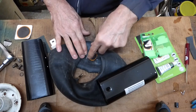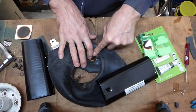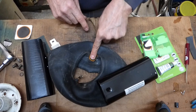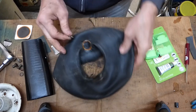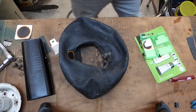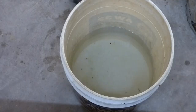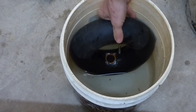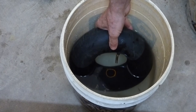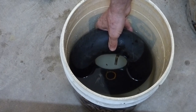We're going to let this sit for at least a minute to dry. Typically they recommend you pull the little plastic cover off, but I'm just going to leave it because this is in a tricky spot and I don't want to hinder the patch at all. We'll put the valve stem back in, put some air in the tire, and put it in a bucket of water — no bubbles! Looking good. That was a tough spot.